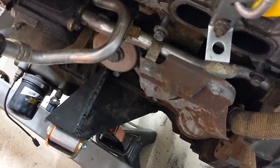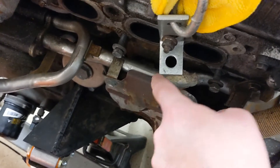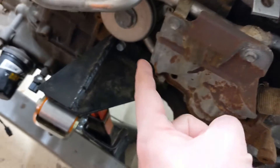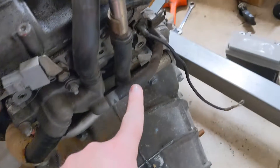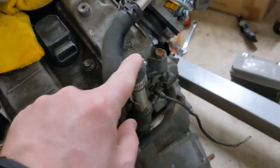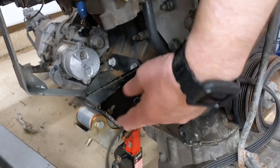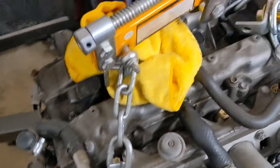So here's how you fix it. This coolant pipe — the thermostat housing is here — goes back here. Underneath this heat shield is a hose for the oil cooler, or oil warmer, whatever you want to call it, so it goes to that. It comes around the back here and goes to the heater core. Then it also comes around this side — these pipes come up to the front to the throttle body thermostat, which is dangling right down here. You've got that one and then the other hoses right there. That's what this coolant pipe goes to.